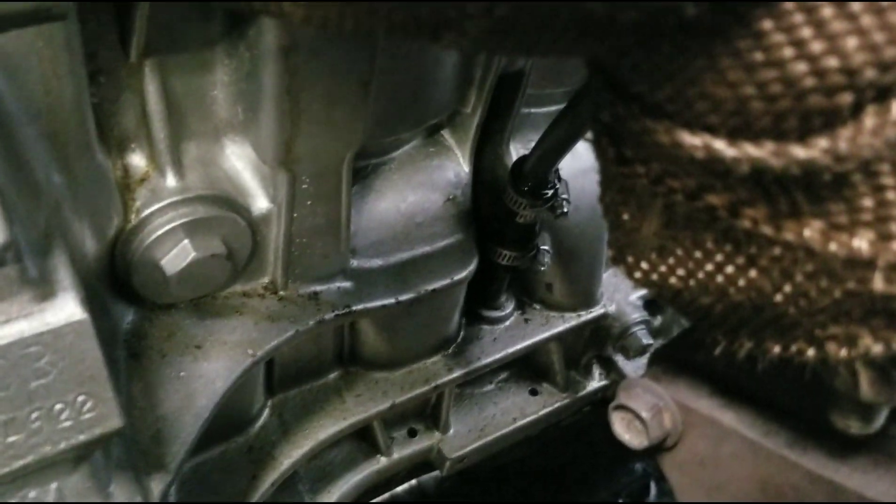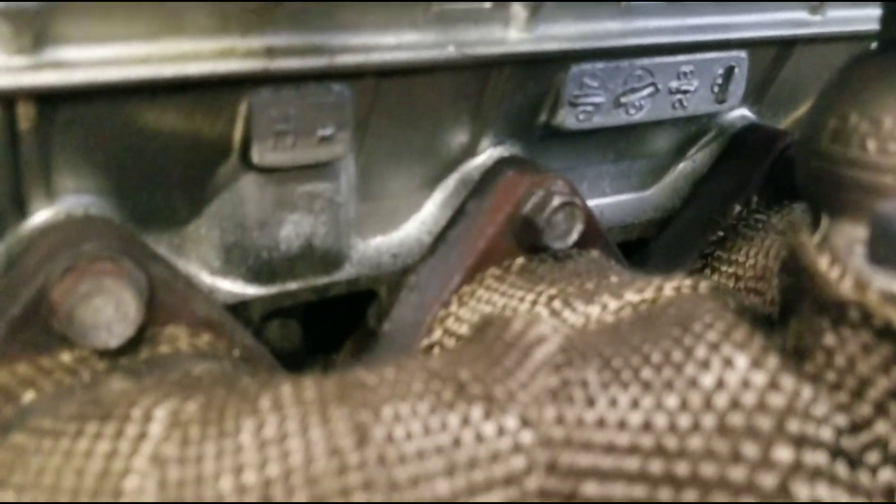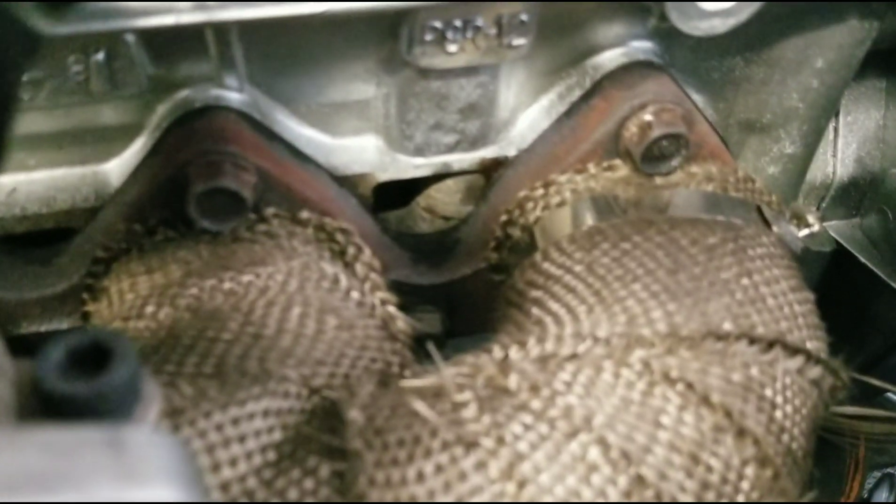You can see it dripping a good amount of oil too. All that has to be cleaned before the next dyno session. Depending on how bad it gets I'm going to have to start charging a cleanup fee — I hate to do that, but there's a good amount of oil trailing down the block. Judging by it, it doesn't look like the valve cover is leaking — looks like a new gasket actually. But the manifold port is a little oily over here, you can see that darkness.